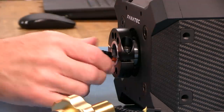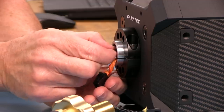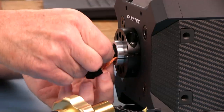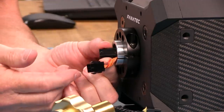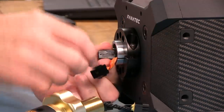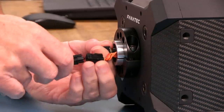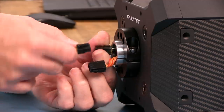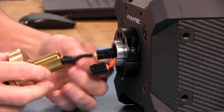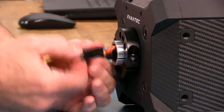So let's plug this back in. I can see the orange one hanging out and the black one has snaked back in, which is not uncommon. I can jiggle the orange one to get it to come back out just enough to get my fingers on it. If you can't get your fingers on it, you can use tweezers or small needle-nosed pliers to grab it — just make sure you don't crush anything when you're grabbing it. Make sure you go black to black — you don't want to get these mixed up because the plugs are the same, so pay attention. Black to black, then we'll get the orange ones plugged in. When you hear that click, you know you're good to go.